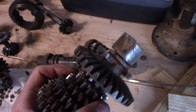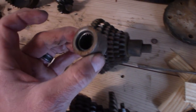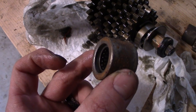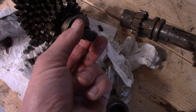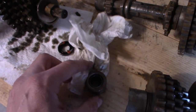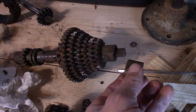There's the other side of the reverse chain, which I'm not a fan of. The other really big difference is on the 820s — those are needle bearings on the inside, whereas on the 205 it's just a bronze bushing. So obviously needle bearings are much better than bushings, especially for longevity and high-speed applications.